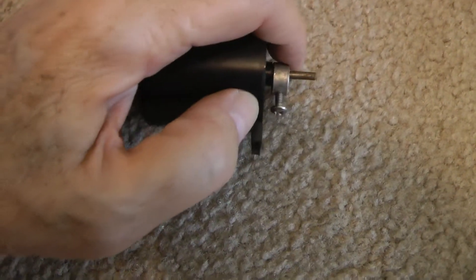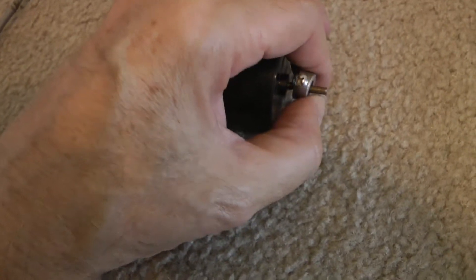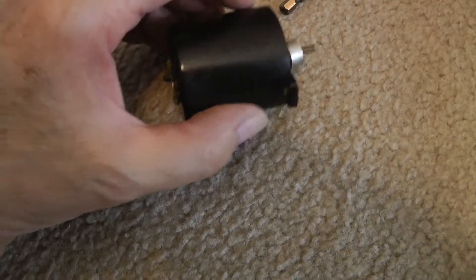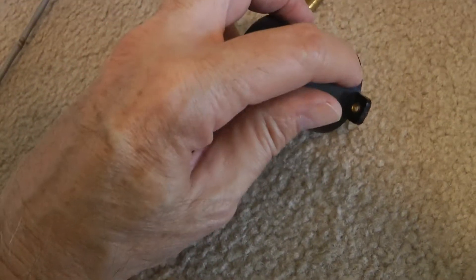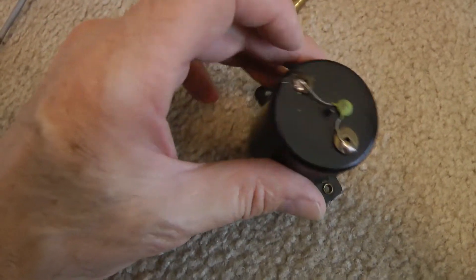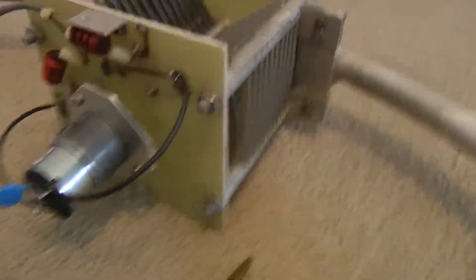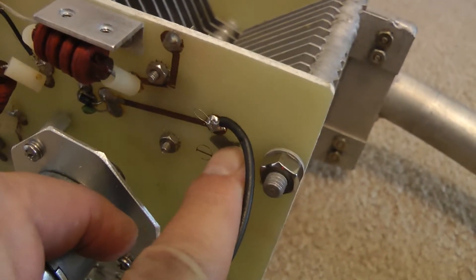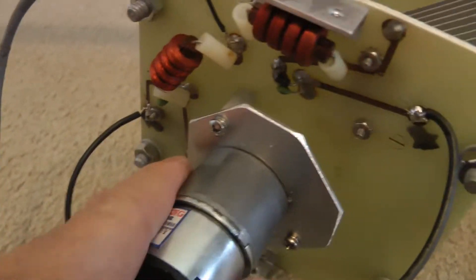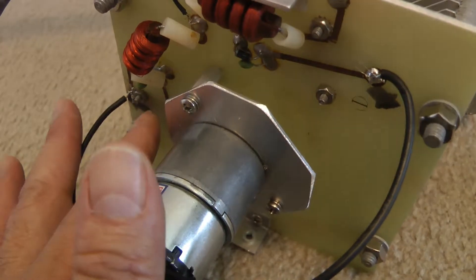This is the old motor, and what I had to do is unscrew this thing from the shaft. I believe the capacitor — I think this is what sort of went into the capacitor or something on the motor. Take the two screws off, one here and one here, and of course wires were going from here to one switch, to the other switch. What I did is I marked both of these — one here with a black marker and one here — because if I pull this out, sometimes you wiggle and stuff and all of a sudden the wire is broken and you think, well, did it go here? Did it go up here? So I just marked it with a magic marker.